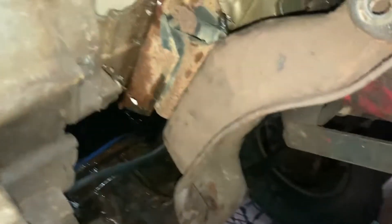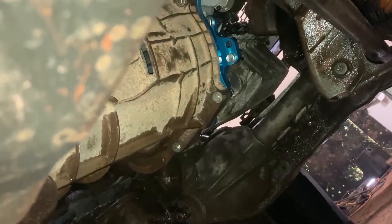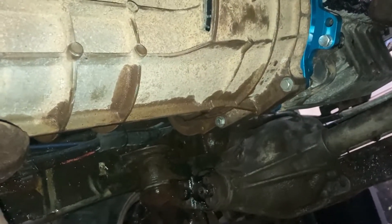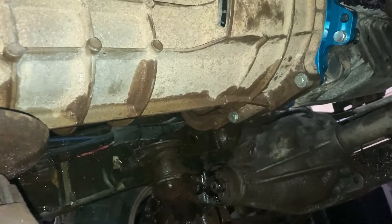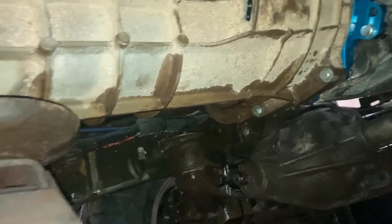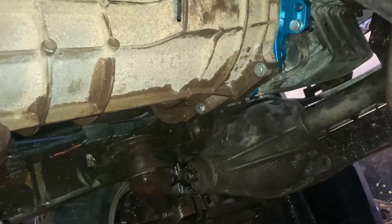A couple hours later — really good progress. Under the truck I've been test fitting basically, seeing where everything's going to line up. I've got the factory mount on the transmission. Getting the transmission bolted up was a bit of a nightmare — the pilot bearing was having a hard time sliding in. My advice for that is get it slid in and don't force it, because if you do you're going to either damage it or push it ahead. I used the jack to lift it up into place, lined it up, worked my way around, got one bolt in to hold it straight.